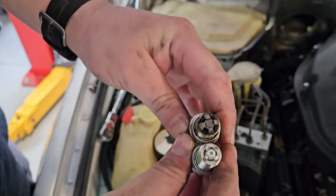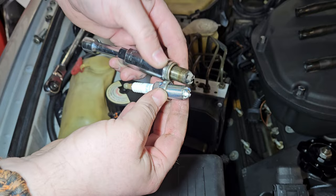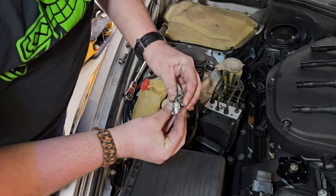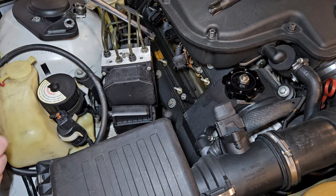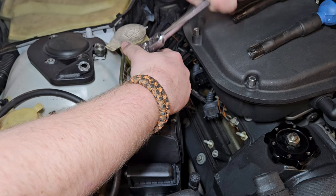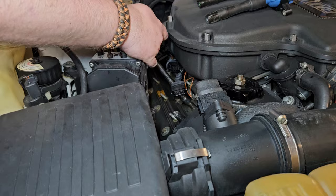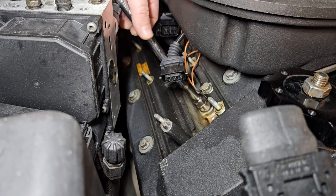Here's a new one in relation. You can really see that they don't burn away — they're not like a single electrode where the gap distance will change and you'll have plugs that are far apart when you pull them out. You don't have to worry about that with these. These are pretty nasty, so I'm really glad I'm doing that. One of these cylinders was directly affected because of where it is in the firing order with the vanos problem — it was a definite misfire. It was affecting one cylinder and I'm not sure which one.